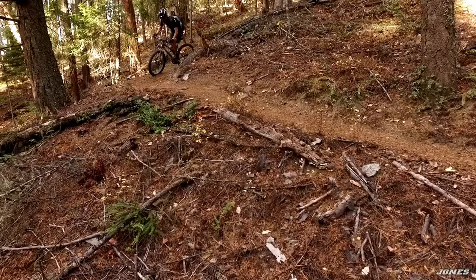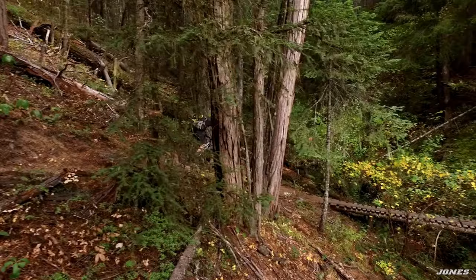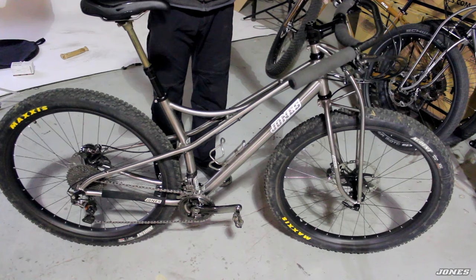Most people were looking for a tight wheelbase. I was sticking with this short wheelbase concept because it makes sense — easier to wheelie, easier to get on the front wheel, easier to bunny hop, less material, lighter weight, tighter turning radius. But I also want a bike that is, of course, laterally stiff and vertically cushy — vertically compliant — so it's absorbing bumps.